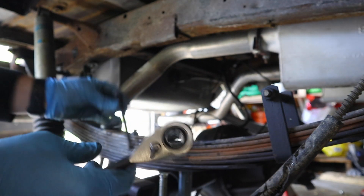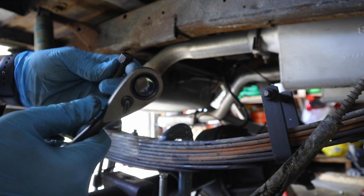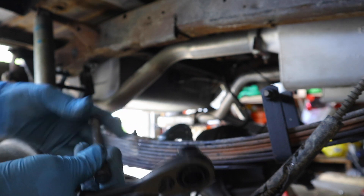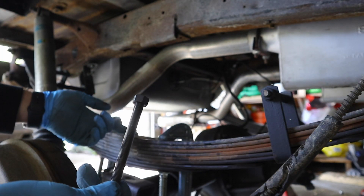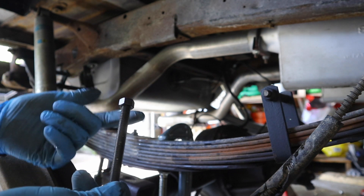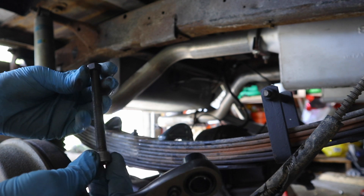This is the bolt that's going through there right now — this one's a little bit longer for the six-degree shim. What's tricky is the bottom of the bolt is just a circle, so there's nothing to really grab onto when you're loosening this. You're only supposed to tighten this down to about 30 foot-pounds, so it's not super tight, but keep in mind you might have to get creative in pinching it to loosen it up.